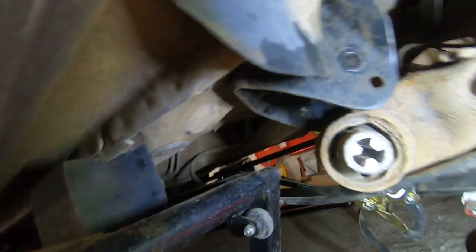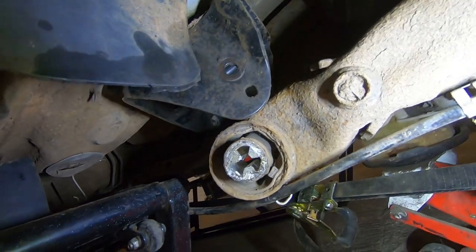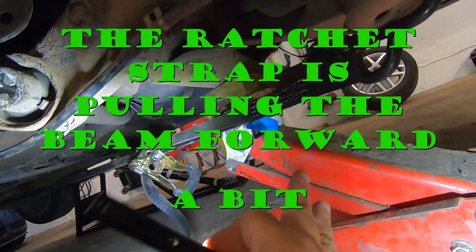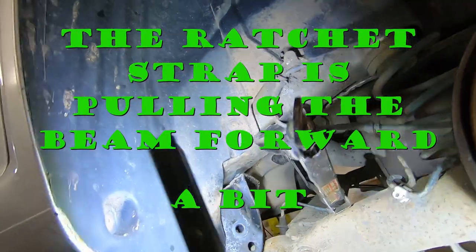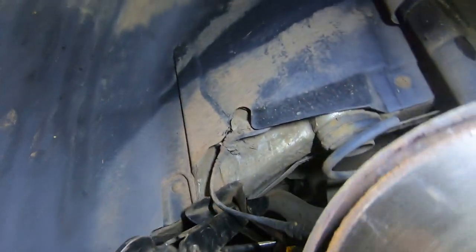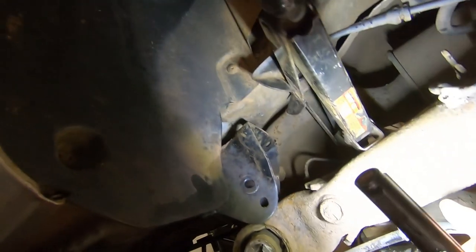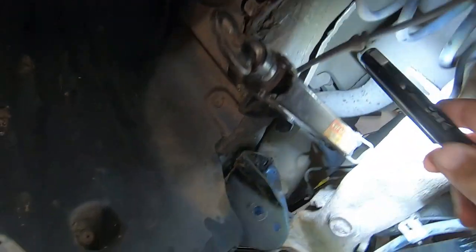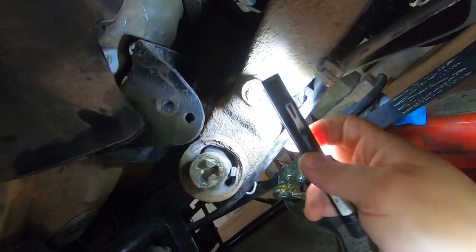So we've got an update on the passenger side, which is the one I'm going to practice on. Basically what we've had to do, we've got the jack there, it's not really doing much, but I've put a scissor jack on top of the arm. Can you see that there? So the scissor jack is just pushing away from the chassis down on the arm. I've unclipped the ABS so it's not tight. Same with the handbrake cable,